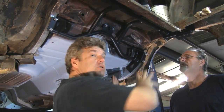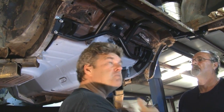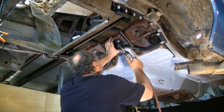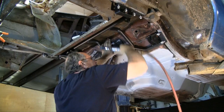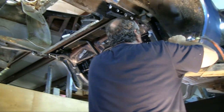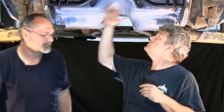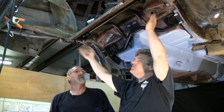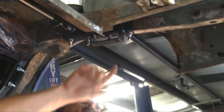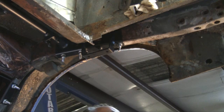You want to go in and kind of loosely set this thing in before you do your final tightening. We've got all of our bolts installed — it's kind of hanging on the bolts right now. Alan's going to go ahead and final tighten it up. When you're tightening this into the chassis, you'll probably want to do the front sections first because those are straight holes. The back ones on the chassis are all slotted so you can get it moving toward the front of the car — these first, those last. On this last bolt, because of the sway bar bracket, you'll need a 9/16 open-end wrench or possibly a speed wrench.